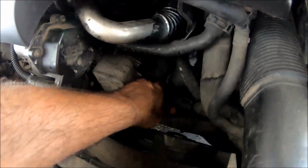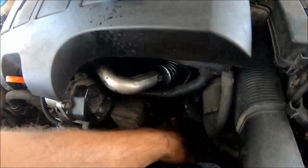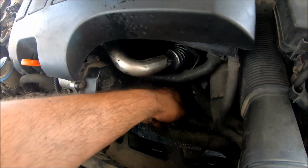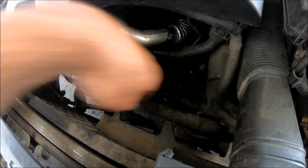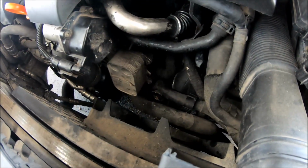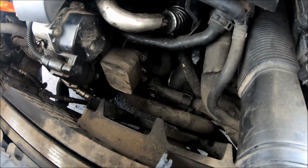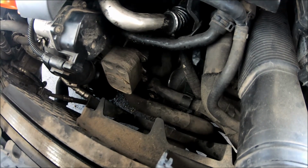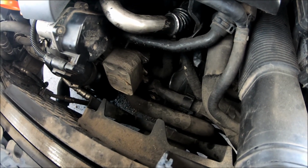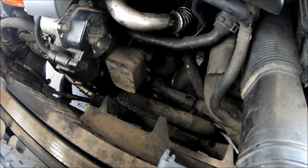And if I touch the hose, I can see if the pump is working or not. You can feel the vibrations of the pump. If the pump is creating noises, then the fan inside the pump is pretty much damaged, and then it needs to be replaced. Or if the electronics of the pump is blown, there is a blown part or something else, then also the pump needs to be replaced.